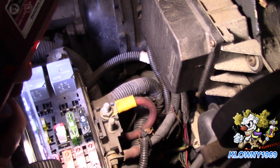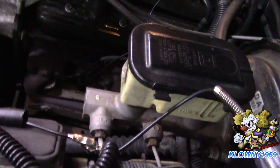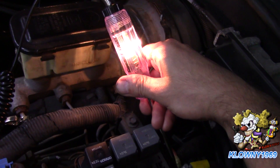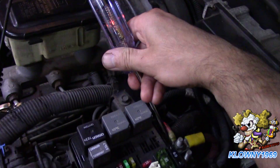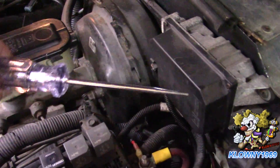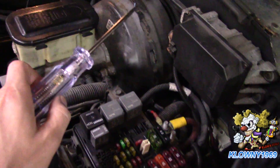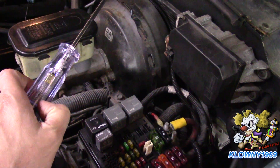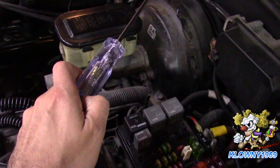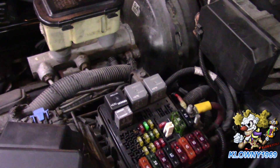I have the tester on a good ground - the master cylinder, the brake lines. As you can see, if I connect the test light with the ignition off, it turns on, confirming constant power. Now to connect an ignition hot source instead, you'd have to put a relay in the circuit so it only feeds power when the ignition is on. That relay has to be able to support the total amperage you're drawing from the fuse block.